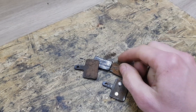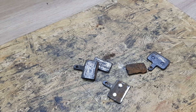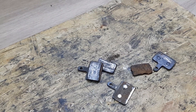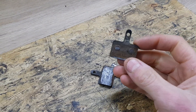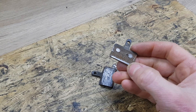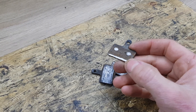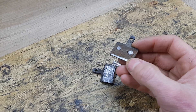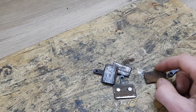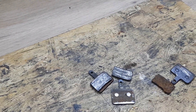The client said that when braking, suddenly both levers just reached the handlebar and there was no braking power — something was ejected out from the brake caliper. You can see the damage here. Before it was thrown out, there was probably still enough oil in the expansion tank on the brake lever that he was slightly able to brake with the back plate — that's why it has such a shiny color here. But the rest was ejected out of the brake calipers as well, so the entire brake system was not functioning.